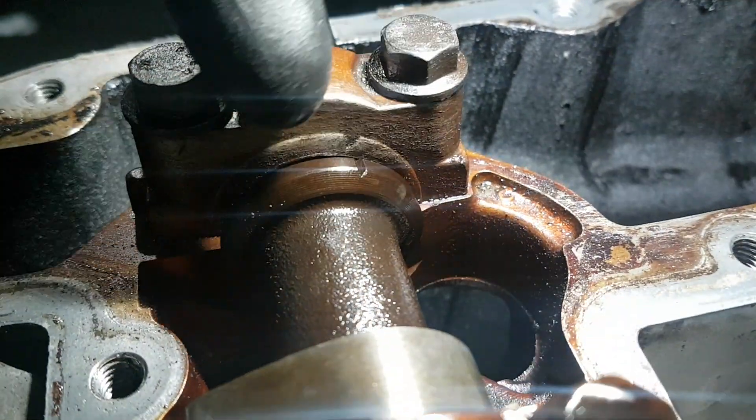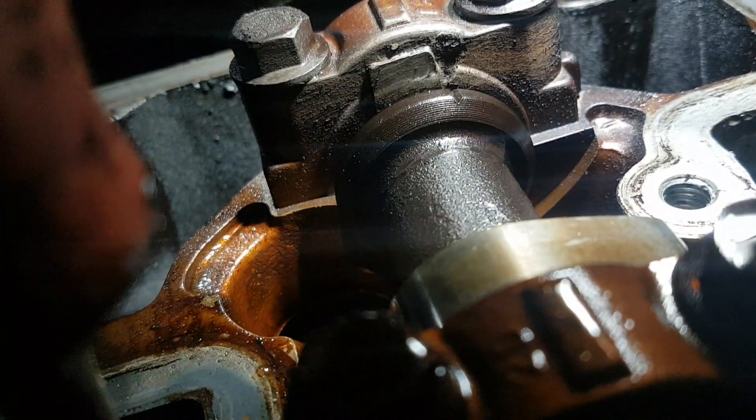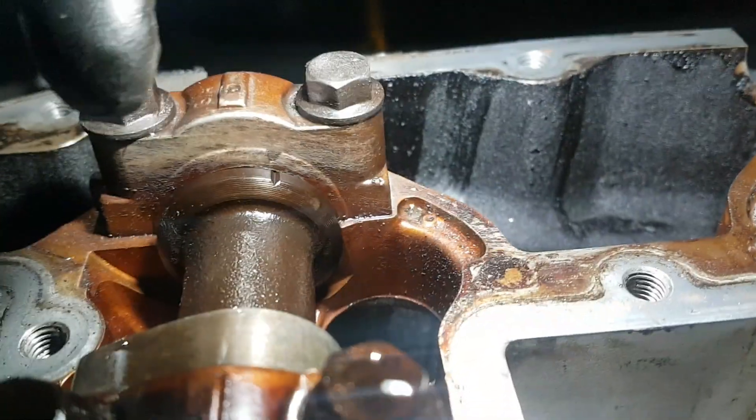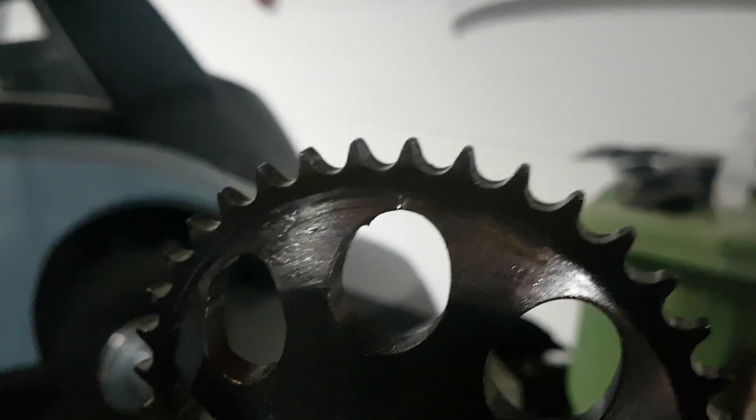On the cams you'll see that line there should line up with that line there. Don't worry if it's not bang on, because sometimes depending on the chain you're putting in there's a little bit more slack. So as long as they're pretty much bang on like that, you're good — that cam's timed up. And then if we look on this side, see that line there? That is your cam timing, and it's exactly the same. It doesn't matter about the inlet or exhaust pulleys — you can put inlet, exhaust, inlet, exhaust, it doesn't matter.